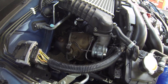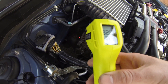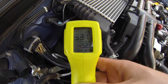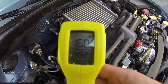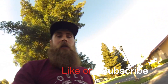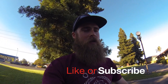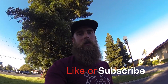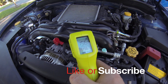So again we got 327 degrees, 317. Let's go to the downpipe real quick — the downpipe is almost 500 degrees, we hit 477 peak. And back to the blanket: 324 degrees, still pretty hot. The intercooler is hitting 160 right there on the fins, hitting 128 or so. It's really doing the trick — otherwise that thing would be wide open. We'd probably be seeing 500 to 600 degree temperatures right after a pull on the turbo itself, and that's just right underneath the intercooler. So I think it's working pretty good.